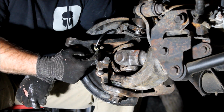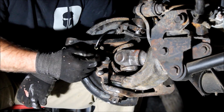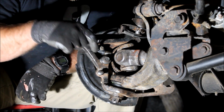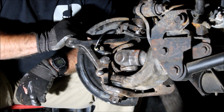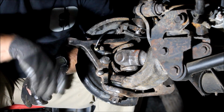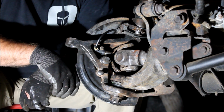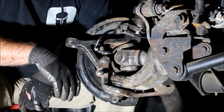so I had to machine, there's a little platform in here that's in the casting, but you have to machine it flat, drill 2 holes in it, tap the 1 hole, so that this little ABS sensor can screw onto it and your ABS will work. So I've been pretty much monkeying with this all day. It's 10:30 at night. I am gonna go home and go to bed. Maybe, just maybe, tomorrow we can actually put the steering on.